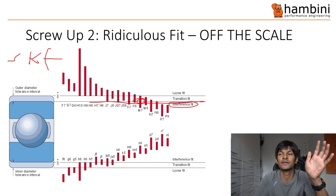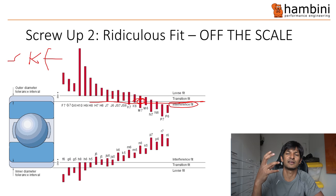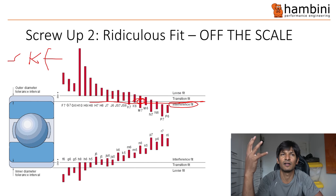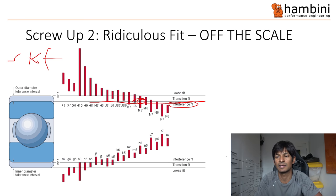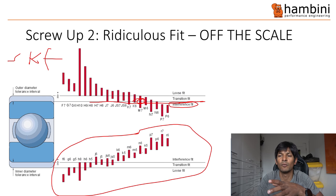There's a general swaying towards a looser fit, and I'm moving towards that as well. The reason is that as you pull the bearing out, if you've got retaining compound holding it in, it doesn't damage any of the surfaces, so you've got much better life cycle. For the shaft fits — the axle through the bottom bracket — the way to note the difference is housing fits have a capital letter, so M capital M7, and then m lowercase is m5. You'll notice the shaft fits tend to have a tighter tolerance grade than the housing fit.